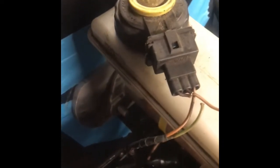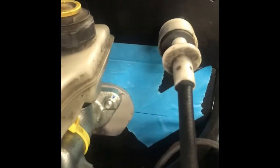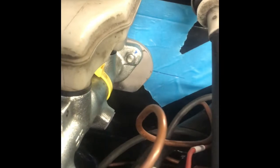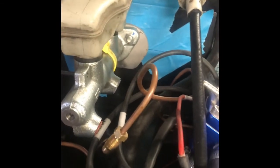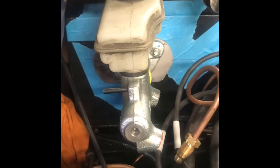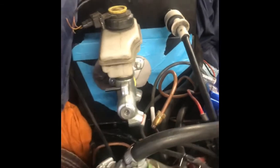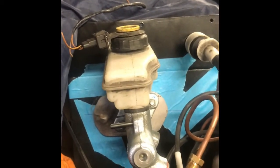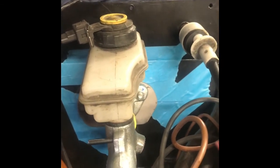There we have it fitted, looking reasonably square. The reservoir is secured with 8mm nuts either side - obviously with locking washers when required. There's an outlet at the back and one for the front in slightly different sizes, so that should give the right pressure and volume for front and rear brakes. I've got a rear range of brake pipes accordingly. I'm going to take the plate off and powder coat it - I've trimmed it down so it's sitting reasonably square. It'll end up being black so it should blend in well with the chassis color behind it.